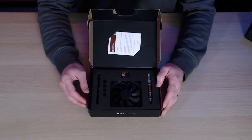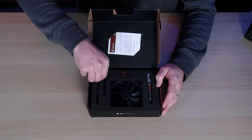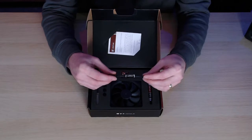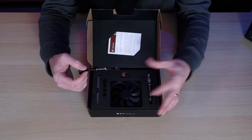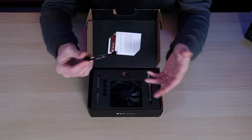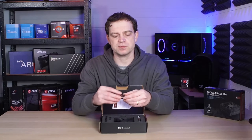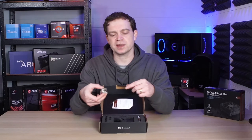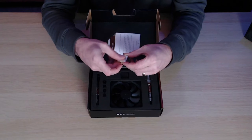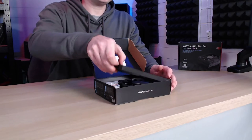We have the fan and cooler in the middle, and four screws which are used to mount the cooler to your motherboard. On the side they provide a low noise adapter, which reduces the total max fan speed from 2500 down to 1800 RPM. So if you don't have any way of controlling the fan speed on the system you're installing this in — and people do tend to install Noctua products on all sorts of weird things — the low noise adapter will allow you to do that kind of control. Another cool but many would say pointless thing is this: a case badge. I haven't seen one of these in years, but it is a pretty premium metal badge — not a sticker like a lot of other products provide. On the back you have 3M sticky tape so you can stick it to your case if you want.